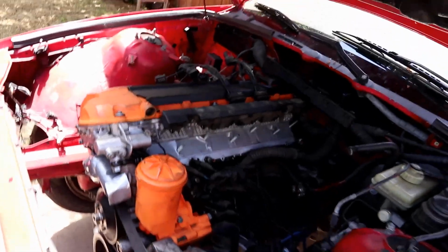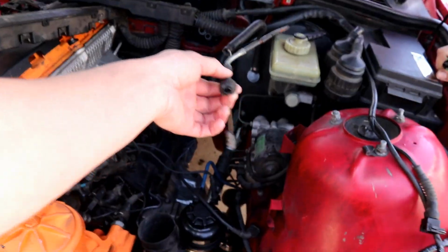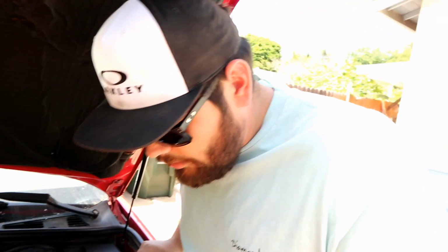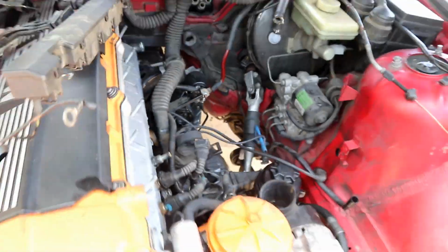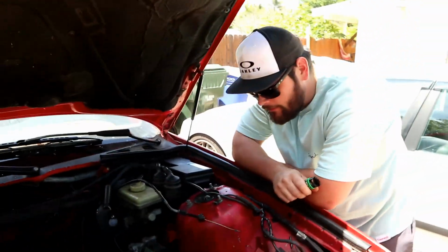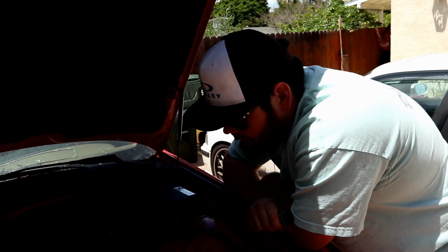And then I kind of wanted to put the intake manifold on and figure out our throttle cable setup, how that's gonna work. Clutch stuff, so we could put the slave and line on. And before the manifold goes on officially, we need to figure out our fuel line setup. We have the rail, we just don't have the lines connected to the rail, so I might try and find some old fuel lines off the M42 and make something work with that. If not, we can just run down to Pep Boys and pick up some line.